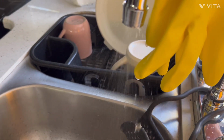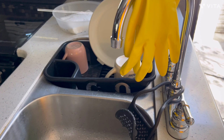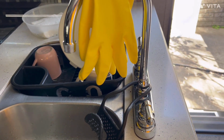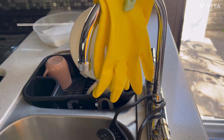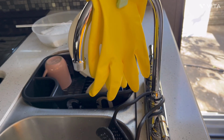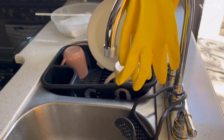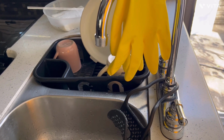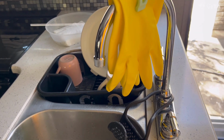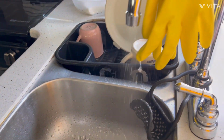As it gets to this point, I'll just go ahead and turn it off. I will do this 3 or 4 times to make sure that I get all the water out. Now, you want to get all the water out, but you're never going to get every droplet out. But I'm going to use my low point drains to drain them out later. And if there's a small amount of water, I've never had any issues. So let's do the cold water.